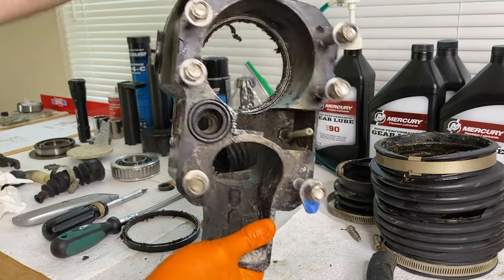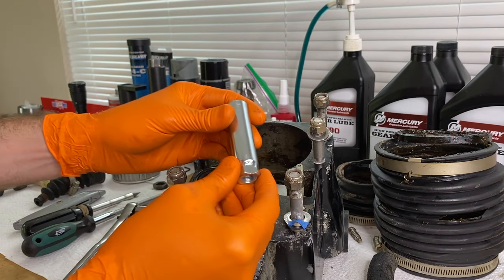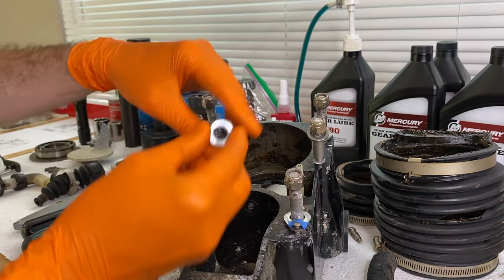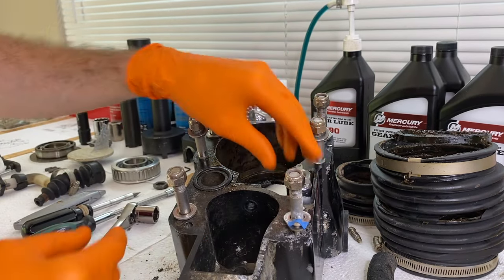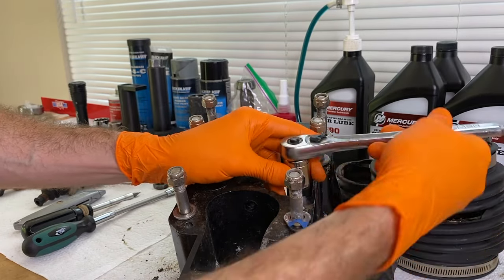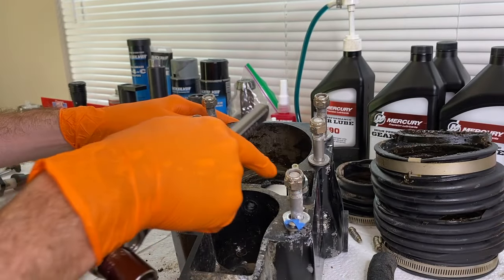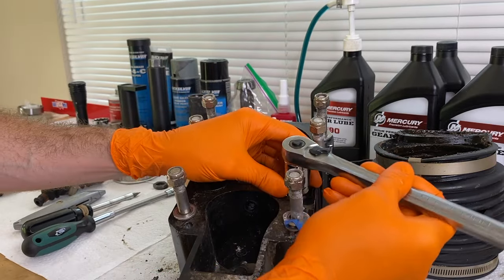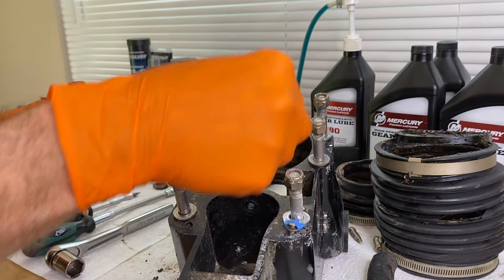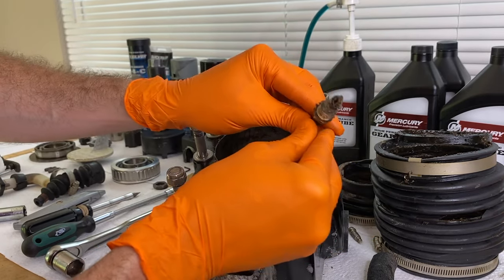Flipping to the opposite side — time to remove the shift cable fitting. In the previous video we discussed this MerCruiser-manufactured part: a long, deep socket specifically designed to remove this fitting from the bell housing. A 3/4-inch socket goes over it. Go ahead and seat the tool with the 3/4-inch socket and unscrew the fitting. We loosened this early in the project — that's why it's now extremely easy to unscrew. If we had not loosened it earlier, removing the fitting with the bell housing not secured to the boat would have been very hard. Remove the tool and unscrew by hand. There is the fitting for the shift cable — all of this will be brand new.